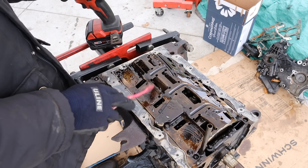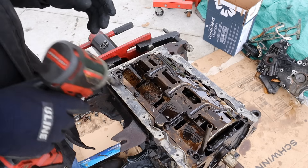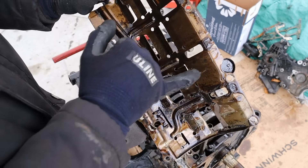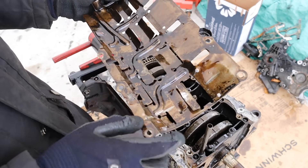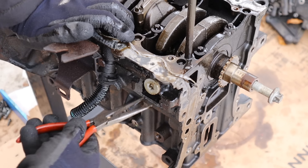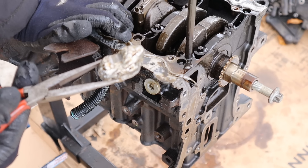Taking a look at the bottom of the engine here, you can see we've got this baffle that's meant to collect all the oil. Speaking of the oil, it does look very sticky — it's not very oily like a normal engine would be. Pop this cover off. I'm actually quite surprised this thing didn't get damaged that much — just a little bit of damage on piston number two and a lot more damage on piston number one, but it didn't completely deform. It kind of did its job to contain most of the mess. There's actually a nice square inspection window where the piston came out of the block, or at least it tried to. That's a piece of a piston head — that's where the wrist pin would sit.